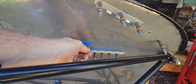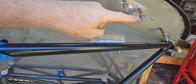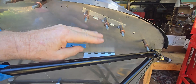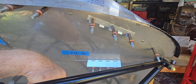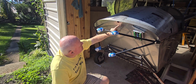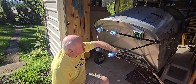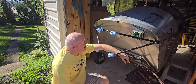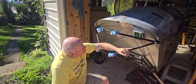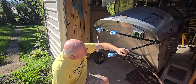Now I'll make these removable using two hinges. The assembly will sit on a slight angle going down, with the hinge on an angle but the aluminium piece that the RDAC box fixes to will be flat, face-fixed either side. I've completed all of the firewall work and put RTV around the fuel catch can overflow. The RDAC is now removable using a couple of leftover hinges — I love using these hinges for removing and fixing things, and it means I can do this without drilling holes in the fuel tank.